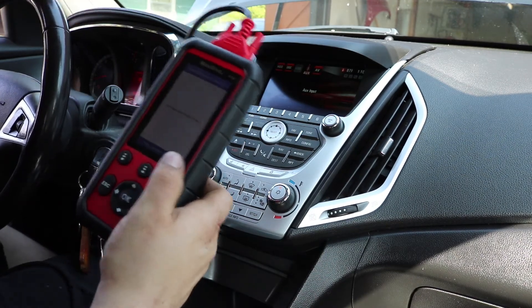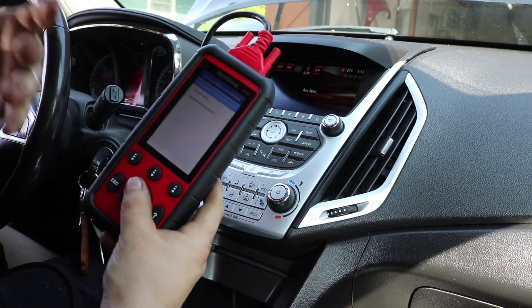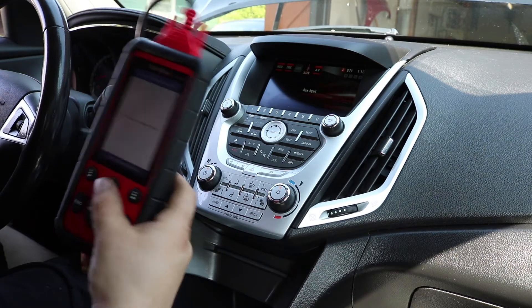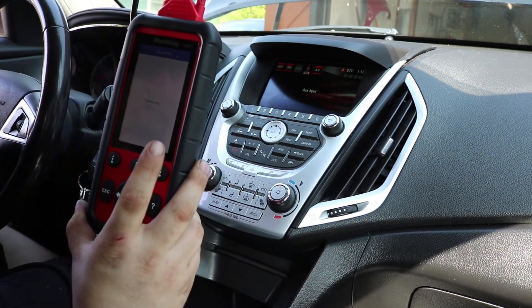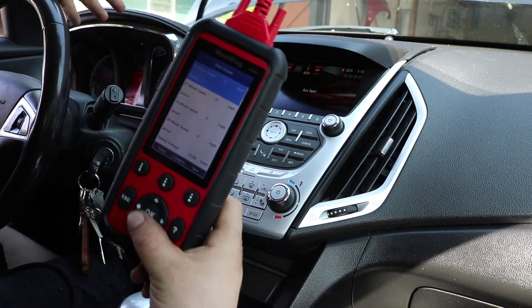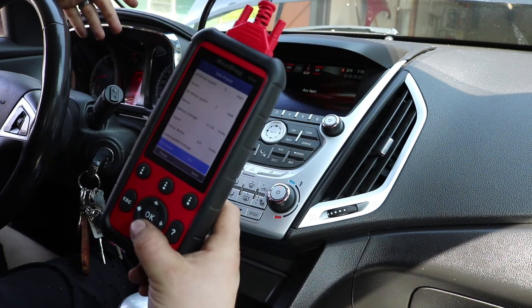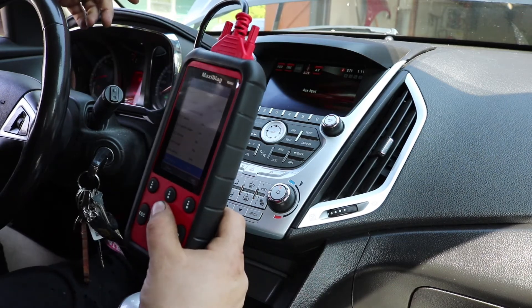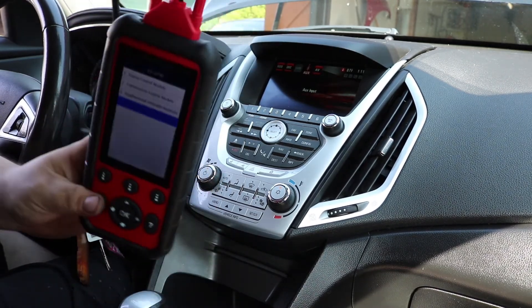You can look up airbag codes — a lot of times an airbag light comes on just from a battery dying. I'm pretty impressed with GM's electronic brake control module coverage too. I do a lot of ABS work with wheel bearings and sensors, and being able to pull an ABS code quickly and view individual wheel speed sensor data — left front, right rear — is great. You can see if the module has 12 volts, whether the pump is activating, whether traction control has failed, switch states, ABS active status. It's very impressive — way more than I expected from an Autel diagnostic scan tool.